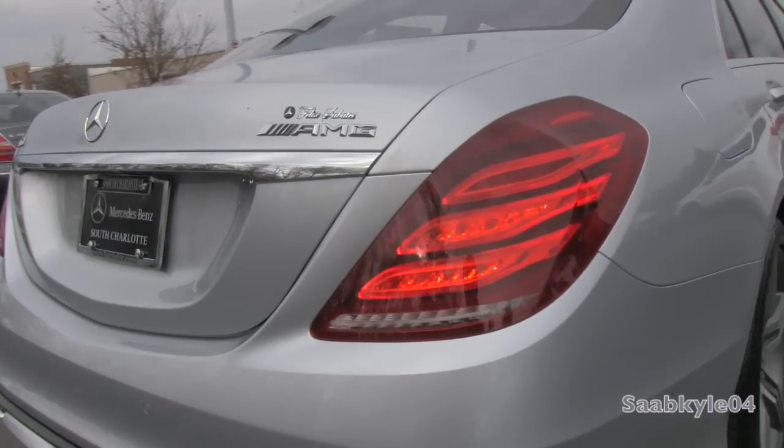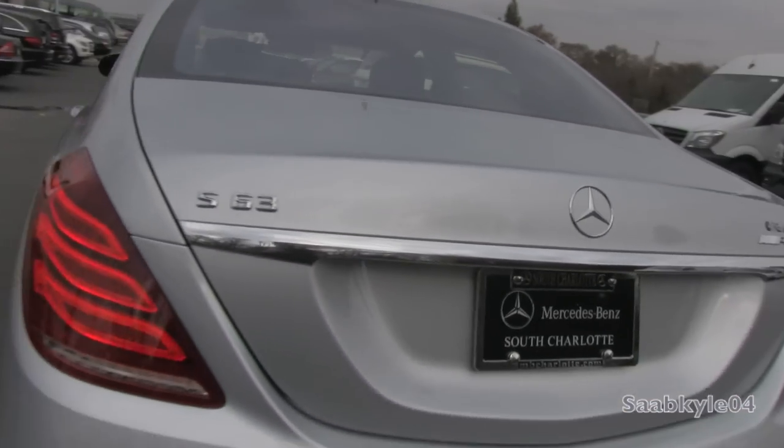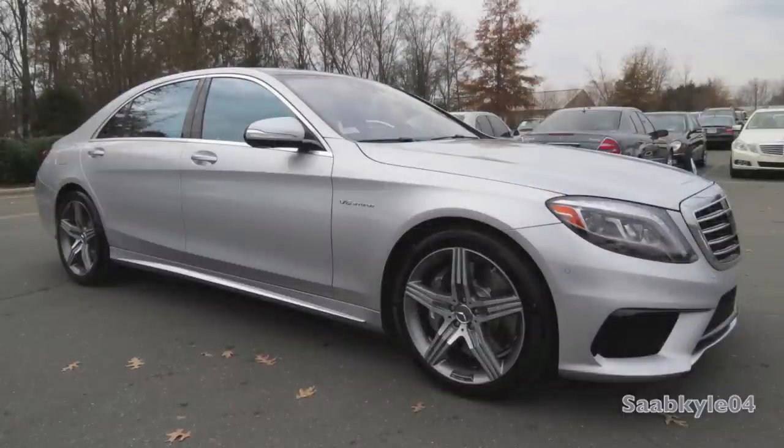But what really sets the MBC system apart are the car's twin stereoscopic cameras mounted above the rearview mirror that can detect bumps up to 45 feet in front of the car and preload the shocks for the upcoming bumps. It works up to 80 miles per hour only when the suspension is in comfort mode and the sensors aren't obstructed, as in a snowstorm, fog, or inclement weather.